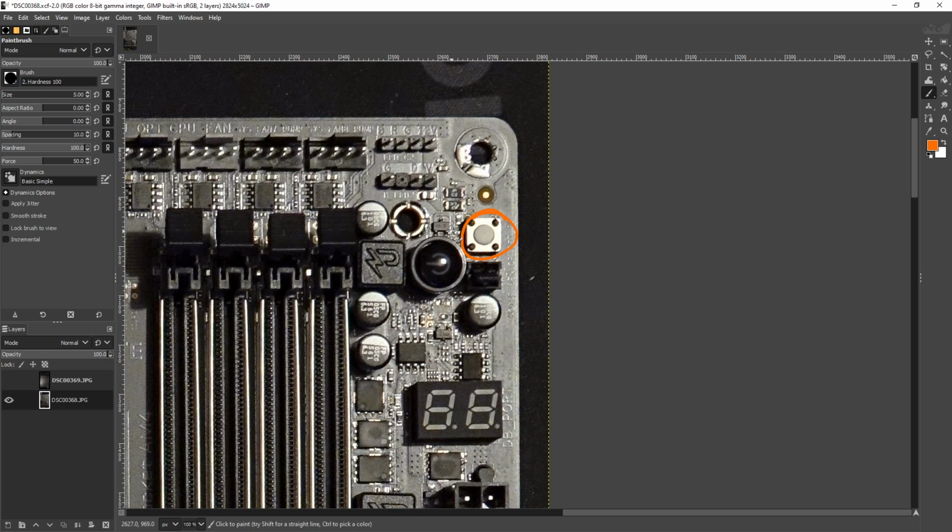And the safe boot doesn't work because this is an AMD motherboard. The way AMD BIOS works is AMD sends a blob of code known as the AGESA to the motherboard vendors. And inside that AGESA is a built-in safe boot function that is extremely unreliable and barely ever works. But also because of that built-in safe boot function that barely ever works, motherboard vendors can't implement their own third-party safe boot function in the form of a button.